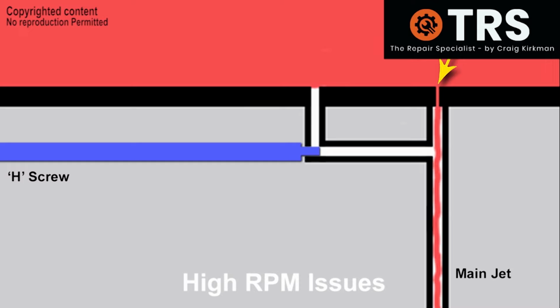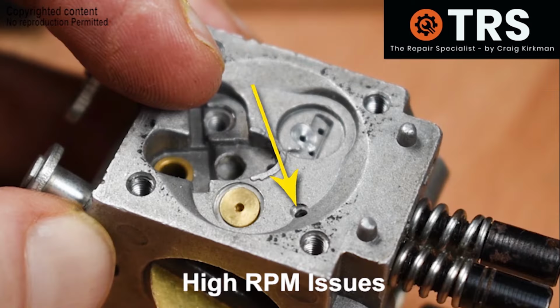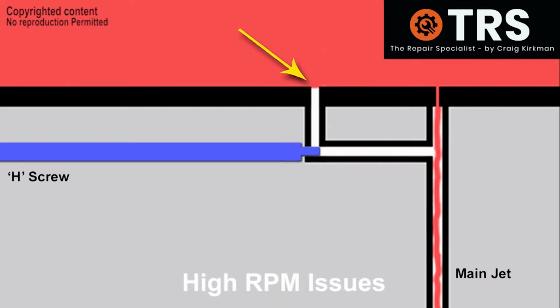So this fuel needs to be supplemented, and that's where this fuel tube comes in. As you can see, this is connected to the main tube and has a wider orifice at the top. This is the orifice we're talking about. It's much larger than that on the main jet tube. So under normal engine running, fuel would enter this tube and then join the main jet fuel. So at this point, it supplemented the main jet and there's enough fuel available for high engine revs.